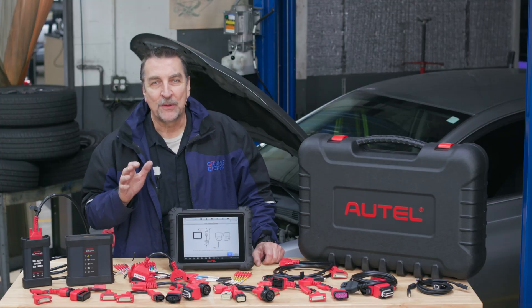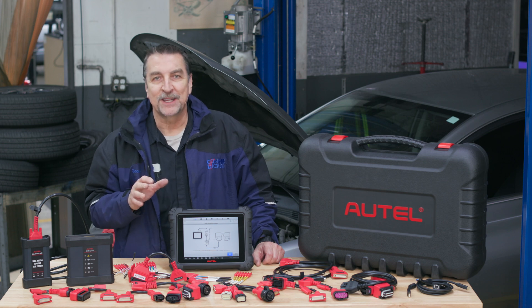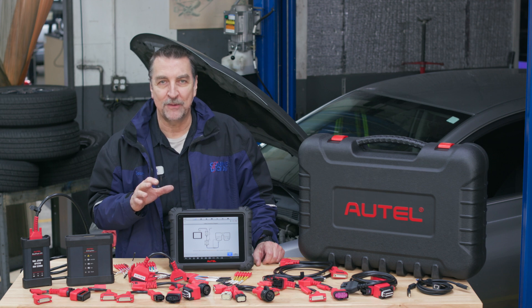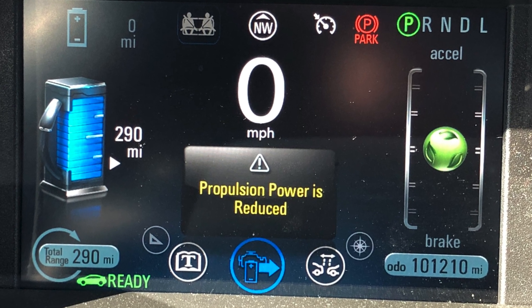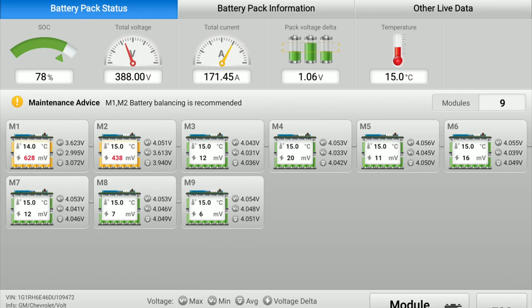To date, I've only connected the tool to a few vehicles and thus far I'm impressed. I used it to connect to my 2013 Chevrolet Volt, which I purchased new over 10 years ago. Now that it has over a hundred thousand miles and went for a year without BMS cell balancing, thanks to a factory issued software update, the battery now has issues — the range is no longer where it used to be. With the awesomeness of this tool, the visualization provides important data metrics for each cell group so one can easily see which group is being affected when the battery is placed under load.